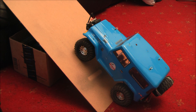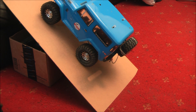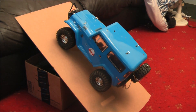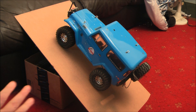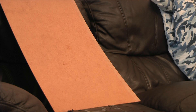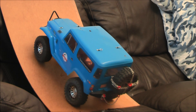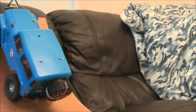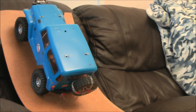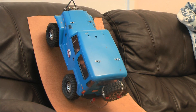I know it's noisy — I've got to sort out the mesh and the spur gear. There we go. That's your drag brake in the ESC, which I thought was 99% there, and it's 100% there because it's ideal for this vehicle. That's the drag brake just holding it there.